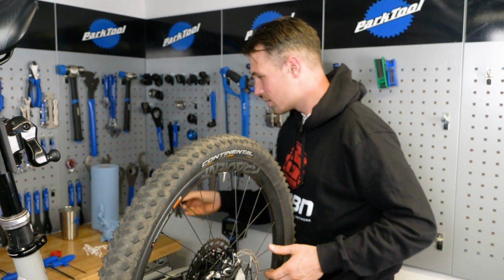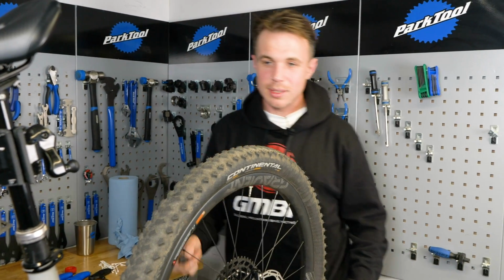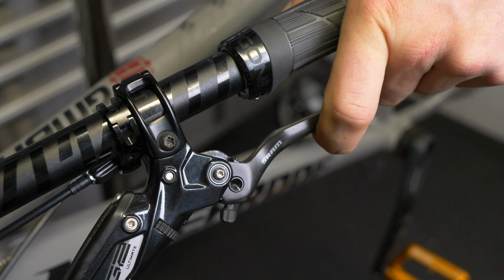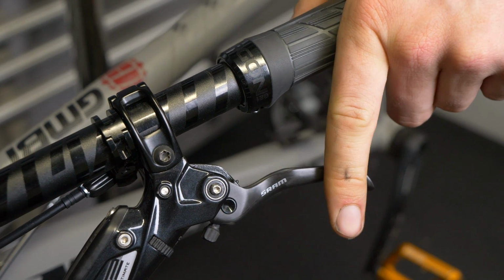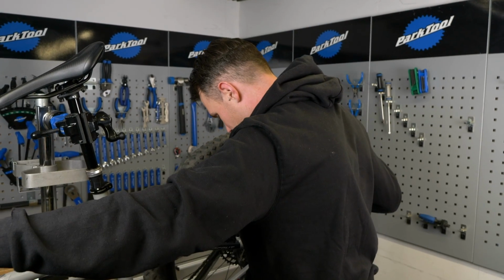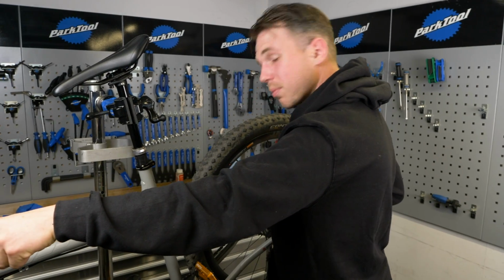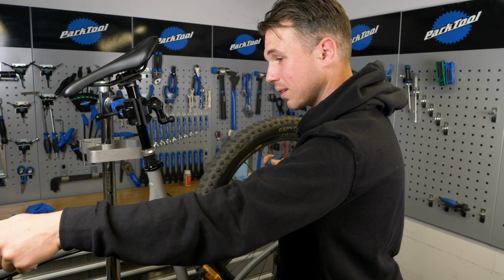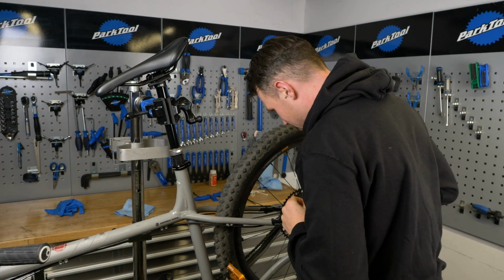Now what we're going to do is we're going to reach for our very small, very clean flathead. And we're going to gently, and gently being a very important word, pull on this lever here. As we pull it, we'll start to get a good idea of what the piston's about to do. And this front right piston is slightly overactive, so I'm going to let go. That's all done for a moment.